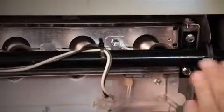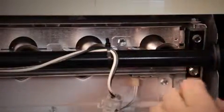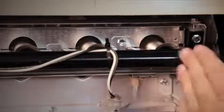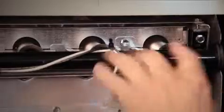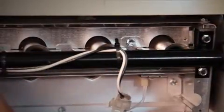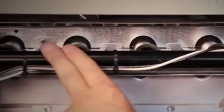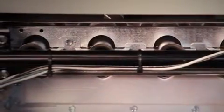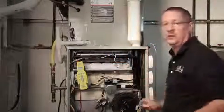When checking out the burner assembly, sometimes we're not lighting all the way across. We want to light the gas on one side and prove that we've lit the gas on the other. If you have a problem with the burners, maybe take the burner at the end, move it to the first place, and shift them all down one. Did the problem move, or did the problem stay in the same place? Figure out what's happening with that burner assembly — why are we not lighting all the way across?